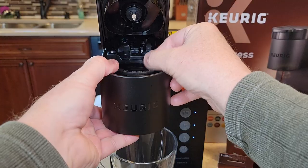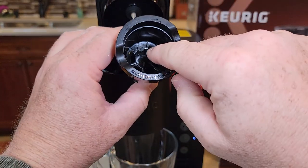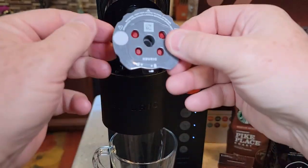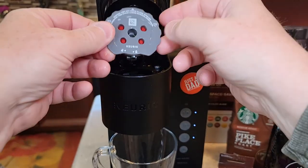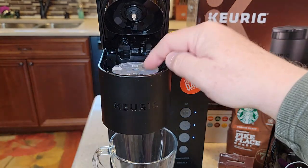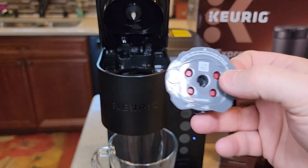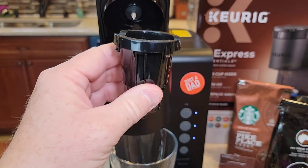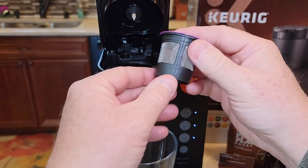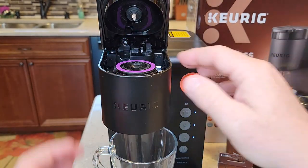You just press up from the bottom — there's nothing sharp at the bottom that's going to get you, the needle's right down in there. The My K-cup has an arrow, and you point the arrow towards the hinge, so it just sits in there. You have to replace the needle basket with this K-cup, then close the lid. It's a little more work but does a really good job — you've just got to take the basket out and put it back when you want to use regular K-cups again.